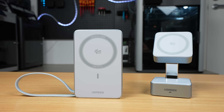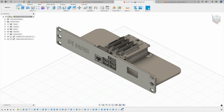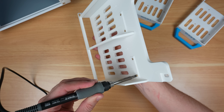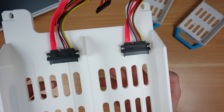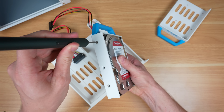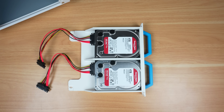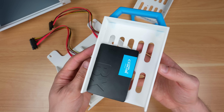I've designed four new shelves — two for drives and two for computers to run the NAS. First up is a 1U shelf that holds two 3.5 inch drives. Each bay has threaded brass insert mounting points for a SATA cable to be screwed in at the back. The drives are installed in pullout trays with screws through the sides, making swapping drives super easy.